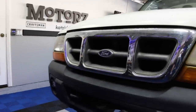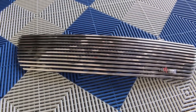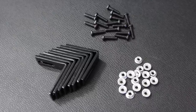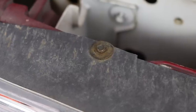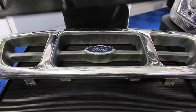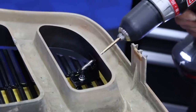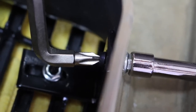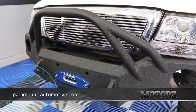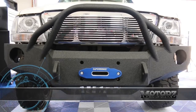With the stock grille being the way that it is, I wanted to improve the look without having to rip it all apart. A quick solution came from Paramount Automotive and this fantastic-looking cover-up grille. It installs right over the top of the factory grille using the provided hardware. Using a 7/32nd socket, remove the fasteners at the top of the grille. Loosely install the provided hardware onto the new grille, place it on top of the factory grille, and then flip them both upside down together. You'll need to drill some small holes just big enough for the provided fasteners to secure the bracket. Tighten everything down, then reinstall. For more information, visit Paramount-Automotive.com.